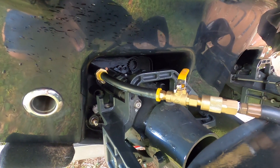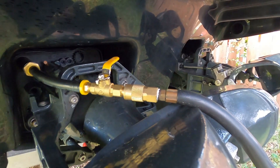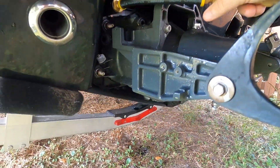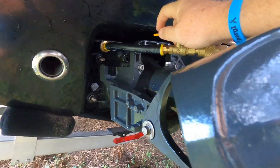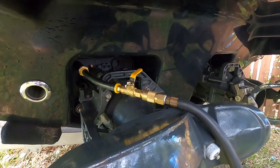You can get this adapter on Amazon or make your own. I have a 30-gallon high-volume air compressor here at 100 PSI. Just keep doing that until you get no more water — that's all there is to it. Good luck, guys. Any questions, let me know. That's a winterized engine.